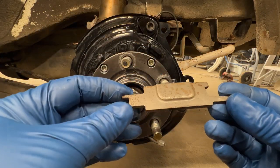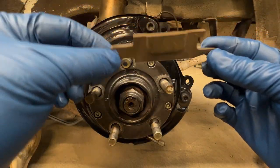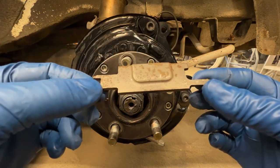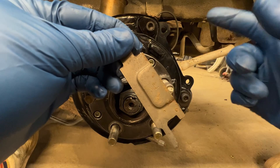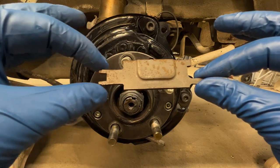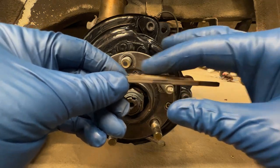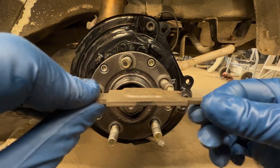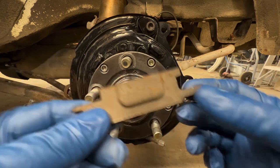The first reusable part is this weird piece. It goes here and it spans between the two shoes. If you take a picture ahead of time, you're going to save yourself a lot of headache. These are directional — it says L for left, and the other side is right. You orient this with the crow's foot going towards the front of the car, and the longer piece going towards the back, with the raised indented part going up.